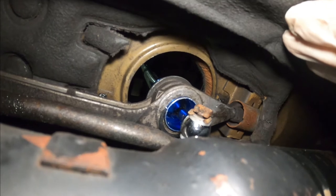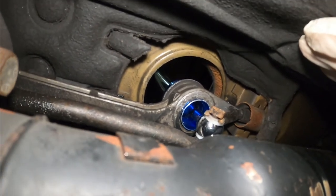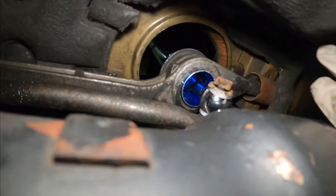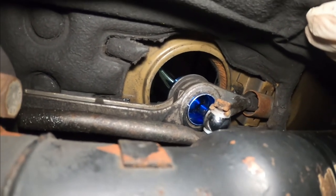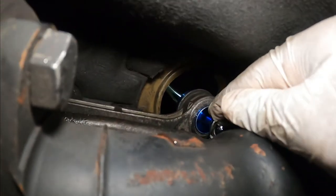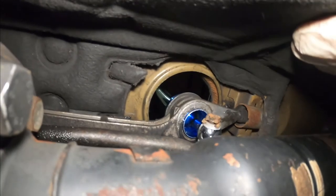This is day two. I did not have snap ring pliers, so I went the next day and purchased some. After installing the ring, I struggled so much and damaged the ring a little bit — you can see it's kind of broken if you look carefully around here. So I have two choices: either I buy another ring or I invest in getting a chassis mounted shifter right now. Right now it is secured and not moving — I tried to bang it to see if it would go up and it did not move. I'm going to try to drive it like this for a few days while waiting for the chassis mounted shifter.